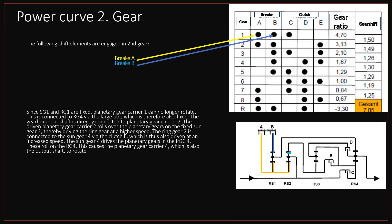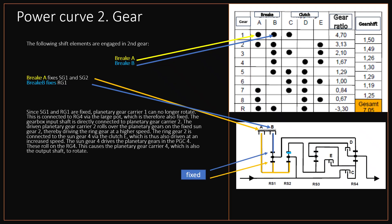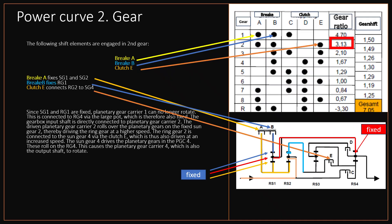As in first gear, brake A and brake B are engaged. This means that sun gear 1, sun gear 2, and ring gear 1 remain fixed. As in first gear, ring gear 4 also remains fixed. The drive shaft is directly connected to the planetary gear carrier 2 and drives it. The planetary gears of the planetary gear carrier 2 roll on the fixed sun gear 2 and thus drive the ring gear 2 at an increased speed. The ring gear 2 is connected to the sun gear via the engaged clutch E. This causes the sun gear 4 to rotate at an increased speed. As in first gear, the sun gear 4 drives the planetary gears in the fourth planetary gear set. These roll off the ring gear 4. This causes the planetary carrier 4 and the output shaft connected to it to rotate. Since the speed increases in the second planetary carrier, the output shaft now rotates faster than in first gear.